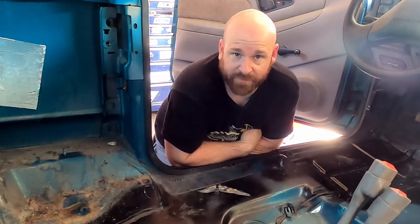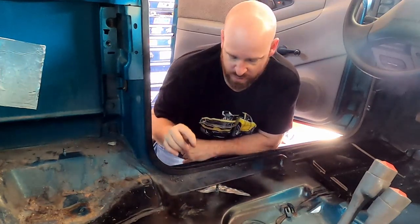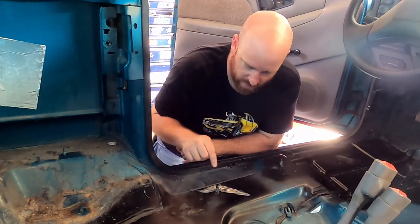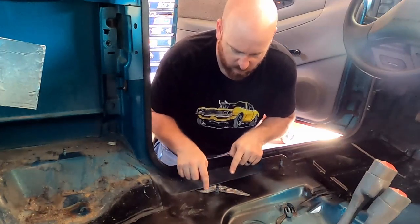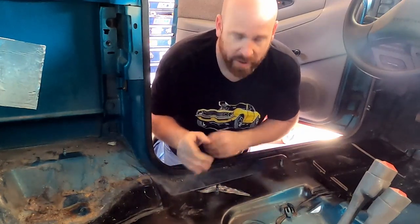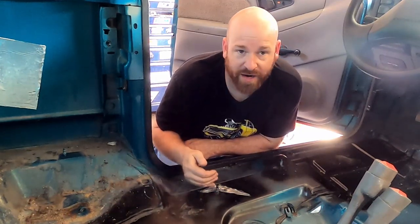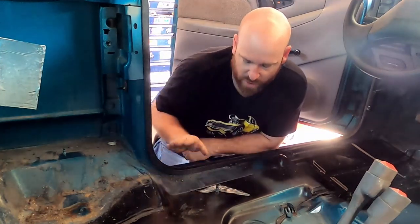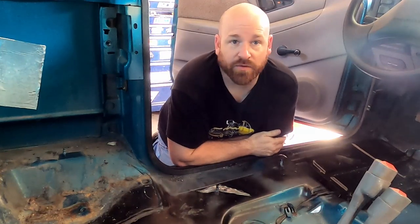Now, I'm not a professional welder. I have one, but I'm not a professional. But what I'm gonna do is I'm gonna start here, and I'm gonna start spot welding. One here, then I'll start in the middle and keep working my way down back and forth. That way I can keep the heat even and keep it from getting too hot and flexing in one area. Do a real quick dirty tack job on that, grind it all down flat. Hopefully that crack's taken care of and we're ready to put the carpet back in